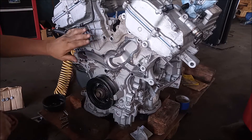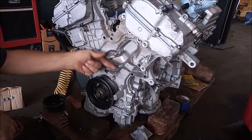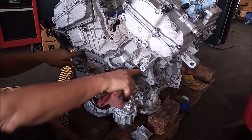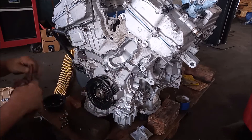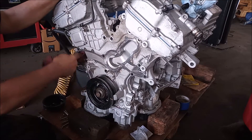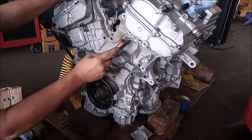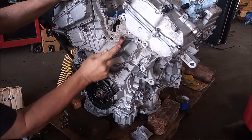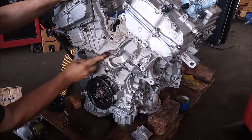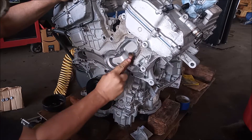While we're looking at this, you can see how the pump is configured. This is the inlet to the pump. The impeller turns right here and forces fluid flow into two separate heads through these two outlets. I'm using a brass brush — it's softer than aluminum, so it should not harm the aluminum surface but will get the gunk off the mating surface.